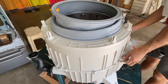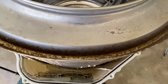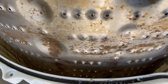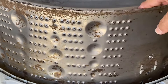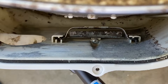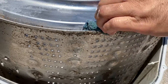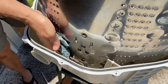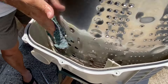Remove the front half of the drum assembly. Look at the built-up grime after years of neglect — several tub cleanings with Afresh and Plink tablet cleaners could not remove this grime. I was not able to separate the inner drum from the back half of the drum assembly. I tried to dislodge the shaft from the bearings with penetrating oil, placing a 2x4 on the end of the shaft and hitting it with a hammer. That failed and I stopped before I damaged the outer drum. I proceeded to plan B, which was to clean the inner and outer drum surfaces as best I could. I found that the grime came off easily with a green scrub pad soaked with water and laundry detergent. The result was night and day.